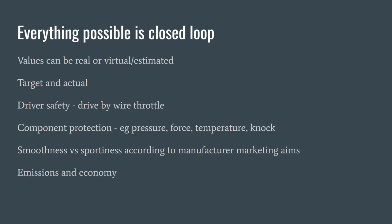A lot of the nature of a torque-controlled ECU like this is to give safety with drive-by-wire throttles, after some of the complaints in previous decades with Toyotas and Audi 5000 and so on, where vehicles would be claimed to accelerate in an unintended fashion. With an automatic gearbox and no ignition key, if you don't know how to shut the engine down, there's concern it could run away with you. So there's a lot of safety mechanisms in these ECUs, a lot of checks and nannies — some need to be moved when tuning, but with care so that you don't delete important safety features.